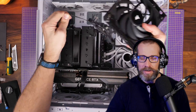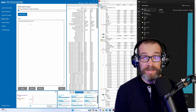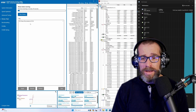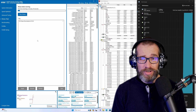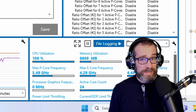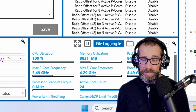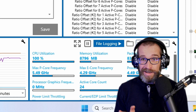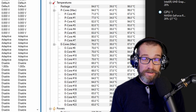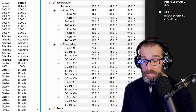I've done a separate video going into a lot more depth on this — I'll link to that in the description — but I went through some stress testing with Cinebench and with Intel's XTU, the Extreme Tuning Utility. I ran some stress tests and found that essentially the CPU wasn't thermal throttling and didn't seem to get too hot under testing. It was doing well under load, which really surprised me — it was outperforming a 240mm all-in-one cooler I'd used previously for similar testing, and yet it only had one fan on it. Pretty impressive.